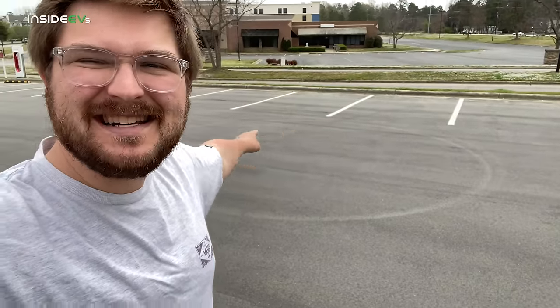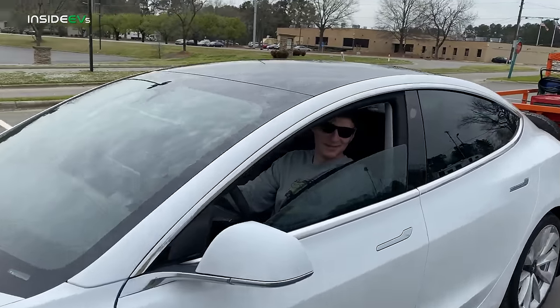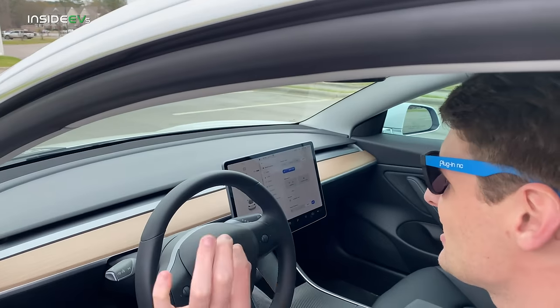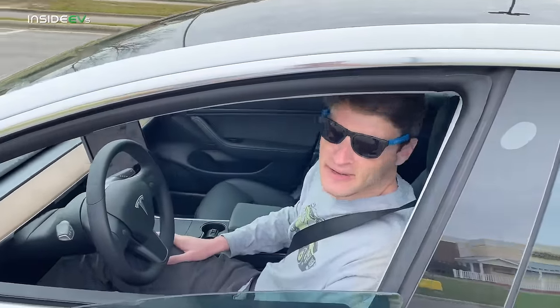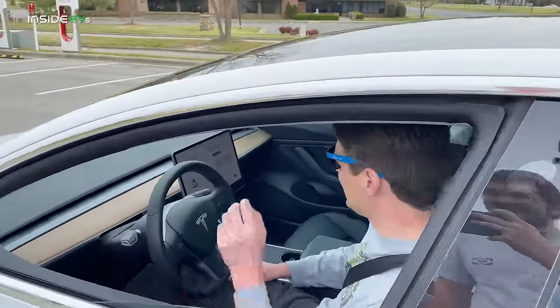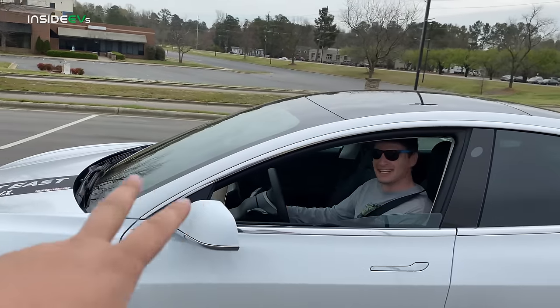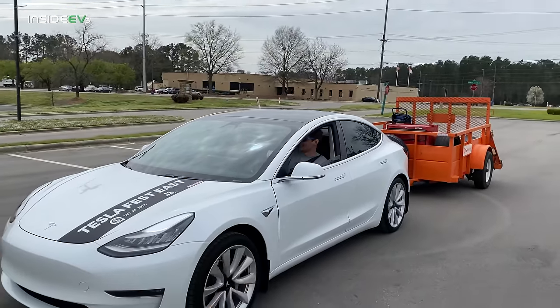The trailer stall is open — let's get hooked up to the supercharger. How was the drive? Easy. 10% battery left. That's 46 kilowatt hours to go 66 miles. To be clear, you drove five over the speed limit with the trailer. Watt hours per mile? 693. To be clear, this car normally uses about 260 to 280 watt hours per mile; Ben's driving style maybe around 300.